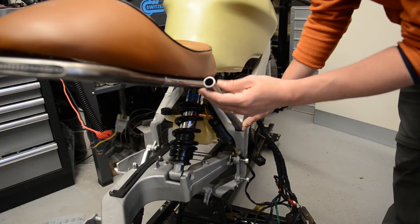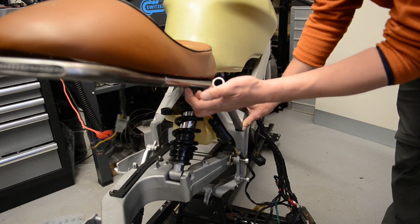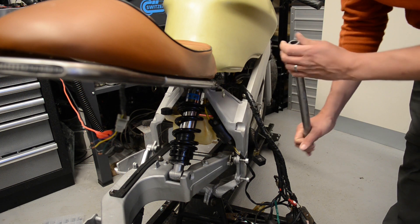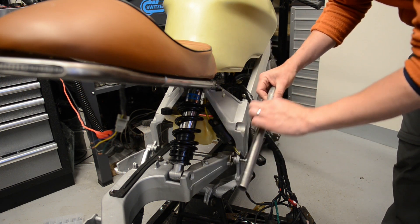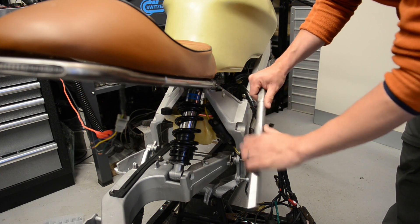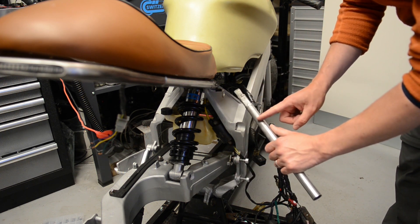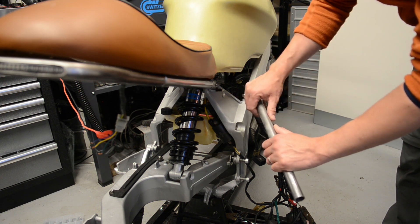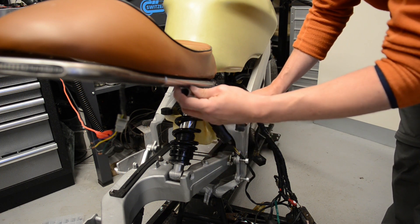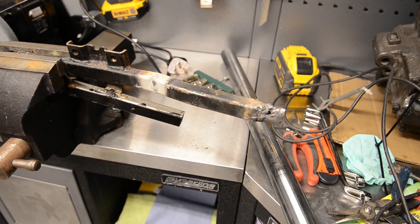I have a small problem - I need to bend this tube. There's a gap of a good bit over an inch from center pipe to center pipe, and I need to do a small bend. I'm going to heat this pipe over a larger area and use one of my old fork tubes to gently bend it. The lower down I bend, the less of a kink I actually need. I just have to remember there's a tube shoved into the middle, so I can't bend both.